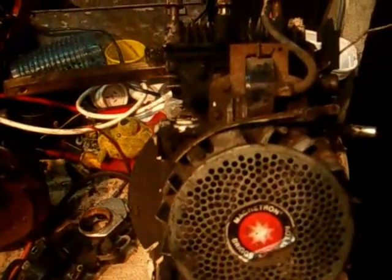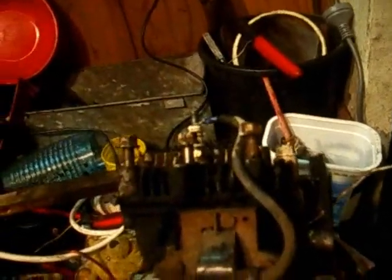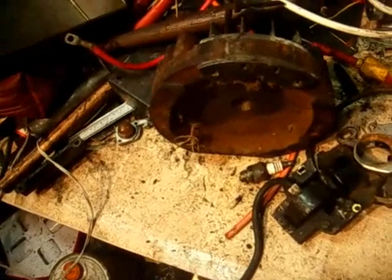This is a three-and-a-half horsepower Briggs and Stratton engine. This applies to Tecumseh, Honda, and most two-stroke engines — they all operate under the exact same principle. The first thing that'll cause a no-spark situation is a failed spark plug, like this one here. It's very gummed up and carbonized. Make sure you have a spark plug that's clean and correctly gapped — about a millimeter gap or similar.